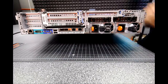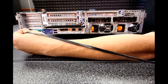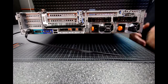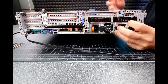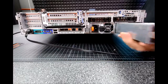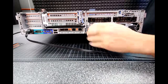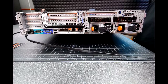All the way over here on the other side is our iDRAC connector. The iDRAC is a lights-out management system specific to Dell. When we look at how the iDRAC works and how you interact with the system, you'll get a better idea of how it functions. Then we have these dual 750-watt power supplies that are modular, redundant, and can be pulled out — notice the orange tabs — while the system is live. So if you have a power supply failure, the system can notify you and you can swap it out.